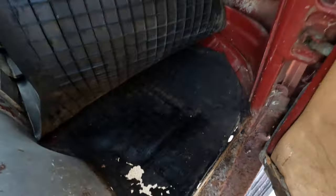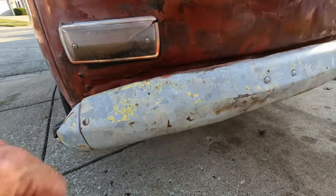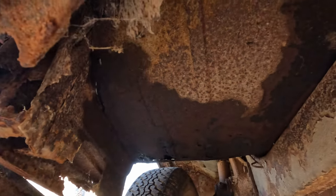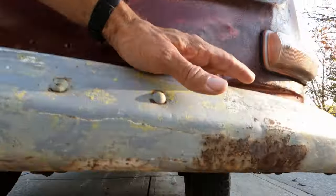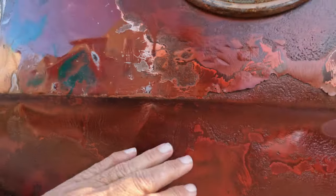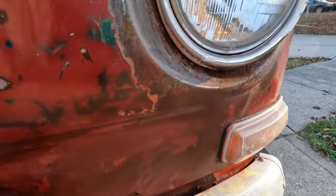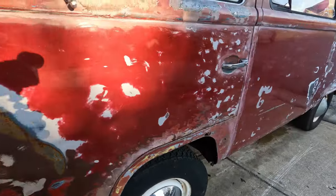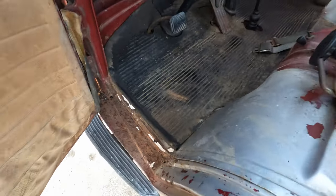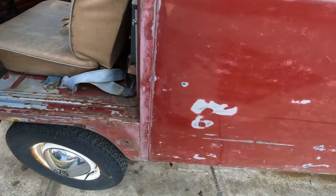The floor pans have a little bit of rust there but they're actually not awful. This is a Midwest vehicle, so this is actually really good for the Midwest. That's the bottom of the floor pan on one side and that's the bottom of the floor pan on the other side — that's the frame rail. We have some dings in the front panel as well. Somebody tried to come in here and pull out a few of them. The other floor pan — this one's a little bit worse, but it could still be patched up. Dog leg — got some rust there, needs some there. Fairly solid.